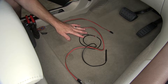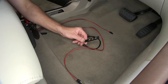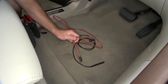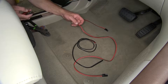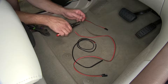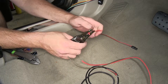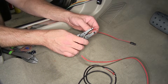We're going to go ahead and set up our monitor light. The monitor light will get attached to the front of our rear view mirror so that it can be viewed from the rear view camera of the tow vehicle. Using the two-pole loop wiring harness provided with the install kit, we're going to create a light that's removable when it's not in use. First, we'll take the two-pole loop and we're going to cut off the pigtail. I'm offsetting my cut a little bit to accommodate for two butt connectors. Once I have the cuts made, we'll go ahead and strip back both sides and add a butt connector to each — we'll use the blue butt connectors provided with the install kit.